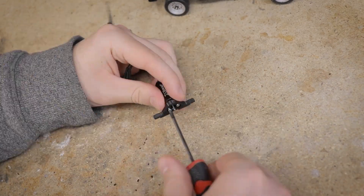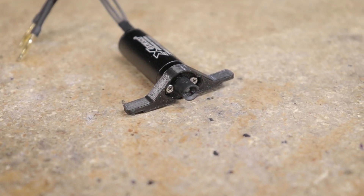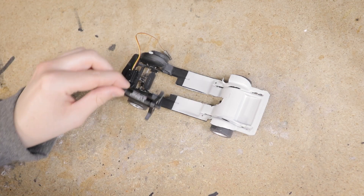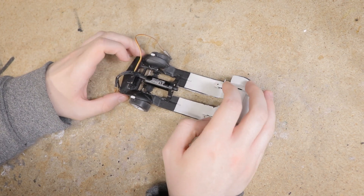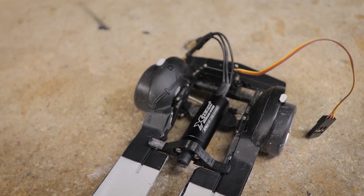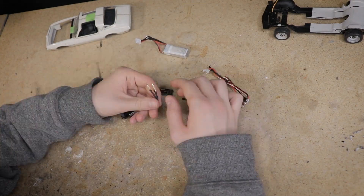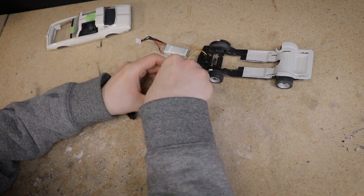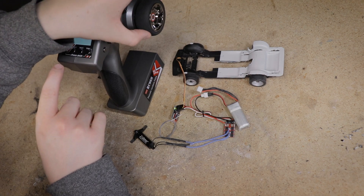I got the motor mounted and test fit on the chassis. I like that the back of the motor can rest on the front suspension cross member, so there's no worry about heat from the motor causing the 3D printed plastic motor mount to sag. Before going any further, I quickly tested all of the electronics prior to mounting everything on the car — always best to do this sooner rather than later. I also went ahead and adjusted the end points for the steering servo.